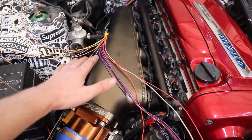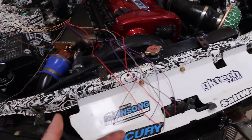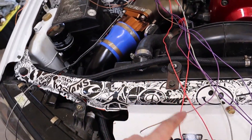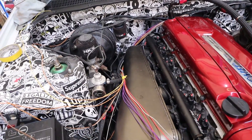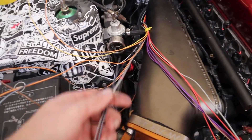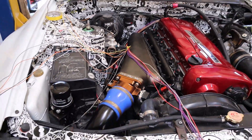These are going to be spare, but obviously with this expansion they may be very useful at some point. If Brad ever wants to do something else, we've got four outputs here — if he wanted to set up some sprayers for his radiator or intercooler for hot track days down the track, he could do that with this expansion. Very, very handy having all this. The 12-volt outputs are things we're going to fold over and cap. My plan is to turn them back and lay them in the harness, cover them up with some braid, shrink it up, get it all looking nice, but leave them in the harness for future expansions. So from here it's just work out my braid and shrink and everything I need before I terminate the ends for the sensors.